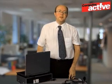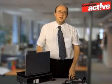Now it's time to take a look at the video player. Don't be fooled if you see a yellow composite socket on the front of the player — this is normally for recording onto the video player, so you won't see anything when you connect to it. The sockets you want will be round the back. If you're very lucky there will be either a composite or S-Video socket there already, but normally there will just be a couple of SCART sockets like on our video player here.